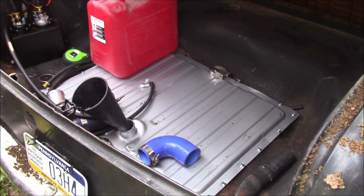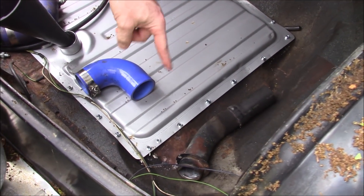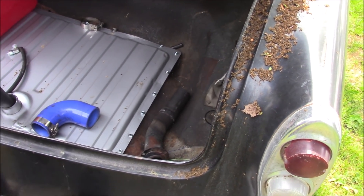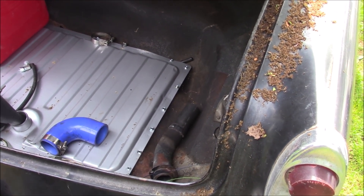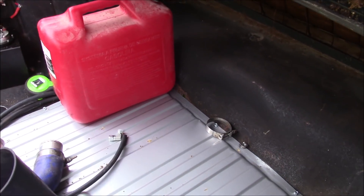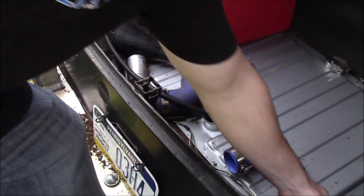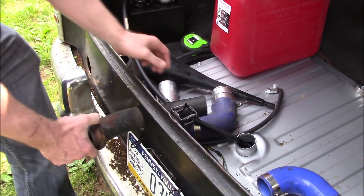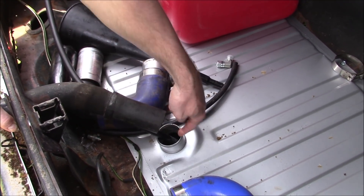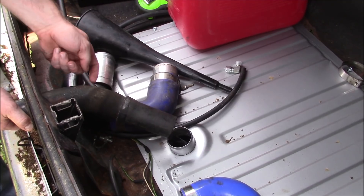The problem was the spare tire used to sit here. I'm not too great with metal work, but I just put a jack under the floor and smashed on it a little bit. The trunk floor was shot anyway - you can still see some of the holes right there. I drilled a new hole for the filler neck, and I'm waiting on a silicone coupling. I've got a 45 coming - a long silicone 2.25-inch - so it'll go right in there, and I can still use my return here.